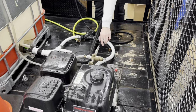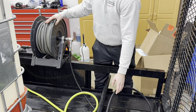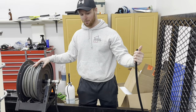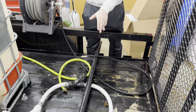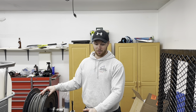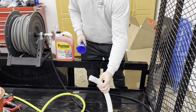You can see we got the pump here, this is our outlet to our loader, and this is the pressure line that runs to the hose. Basically what we're going to do is disconnect this one and blow it out with an air compressor, then disconnect the inlet to our pump and pour antifreeze in through the inlet. We'll cycle the pull cord on the engine a few times with the key in the off position so you don't get spark and the pressure washer doesn't start on accident — but that's going to cycle that antifreeze through the pump and prevent it from freezing.